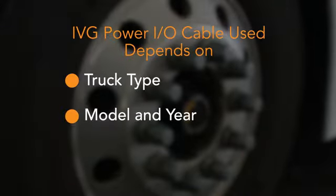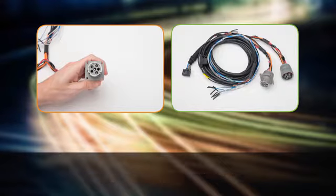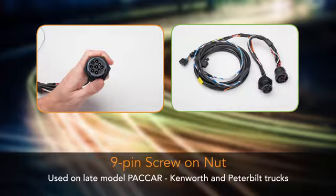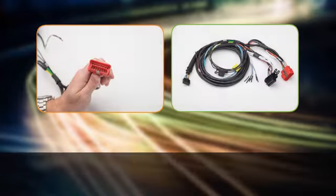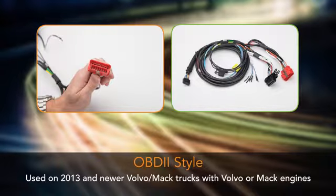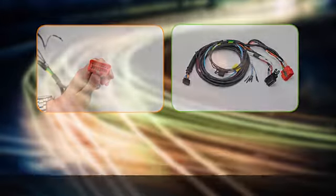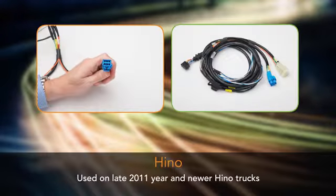a 9-pin flange used on most 2006 and newer trucks. A 6-pin used on most 2005 and older trucks. A 9-pin screw-on nut used on late model PACCAR, Kenworth, and Peterbilt trucks. OBD2 style used on Volvo Mack trucks with Volvo or Mack engines manufactured in 2013 and later. Hino used on late 2011 year and newer Hino trucks.